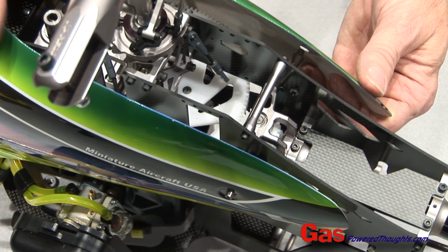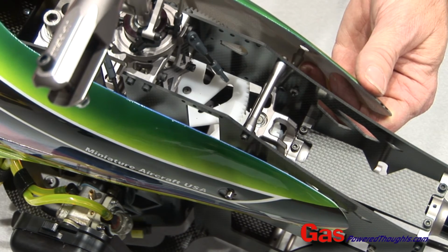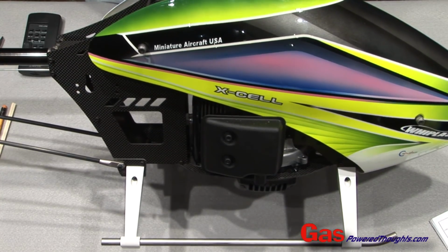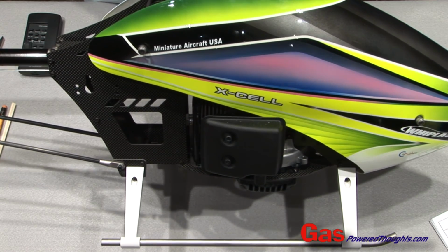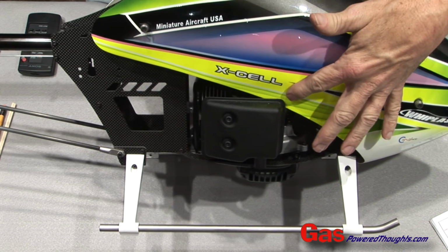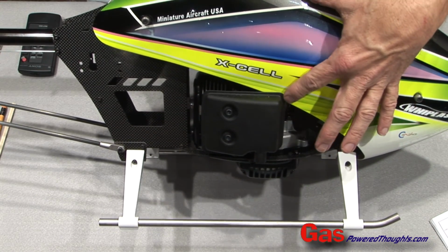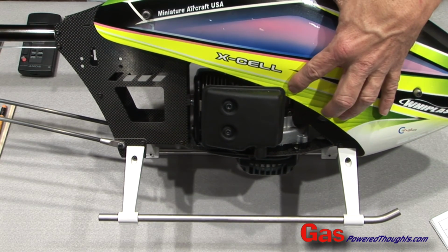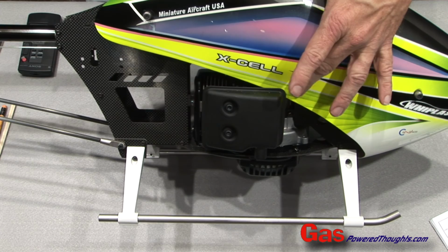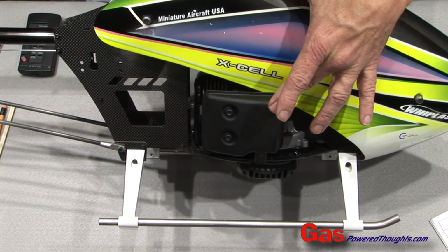And then we put the grommets in. Once the holes are reamed, we put the grommets in and can put the canopy mounts on. With that, we've got the canopy mounted. One more note, if you're using the stock can muffler, you're going to need to trim the canopy just a slight amount here because there's an interference area. I suspect most people are not going to use this muffler, so it won't be an issue. The aftermarket muffler's clear without a problem.